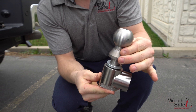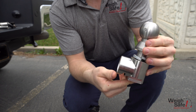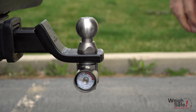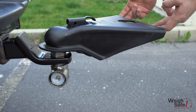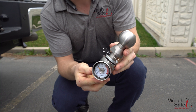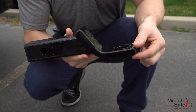It is made from high-corrosion-resistant 303 and heat-treated 416 stainless steel components. The hitch ball provides a connection point for the trailer coupler. It swivels on the main shaft, helping reduce the wear and tear on the ball itself, as it will swivel with the coupler as the trailer travels and turns. The main shaft is 1-inch in diameter and fastens to a ball mount that measures 3/4-inch thick.